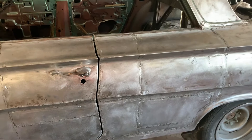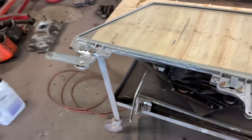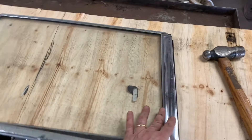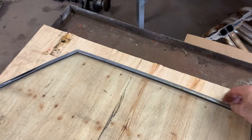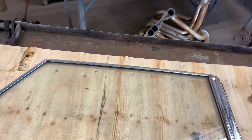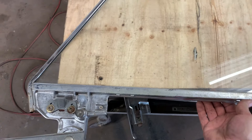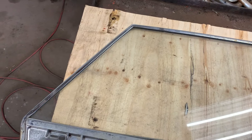I'm going to make an assumption: since I added eight inches to the front door and cut eight inches out of the back door, I think this is probably going to be eight inches shorter. So what I'm going to do first is get the glass out of this — take this trim off, take the centerpiece off. If I'm thinking right, I should be able to cut this top piece of trim back eight inches and save that piece for the front glass. This piece here is a cast piece — it's pot metal, you can't really weld this, so I'm going to have to figure out how to take eight inches out of it and put it back together and stabilize it.